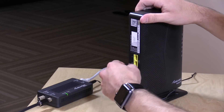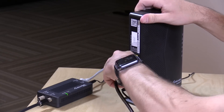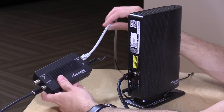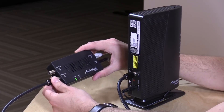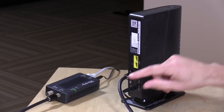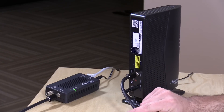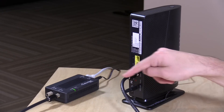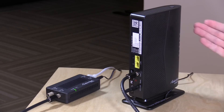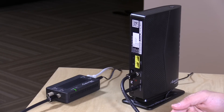So what we're going to do is apply power and then plug in our cable wire. The way this is set up is that this MoCA device is plugged into my router via Ethernet. This wire here is our cable television wire, and that will run around your home to the other device. All the data is transiting via this coax cable — same wiring as your cable television — from one end to the other and back again. What I found in my testing is that there is very little noticeable performance decline as you get further away.